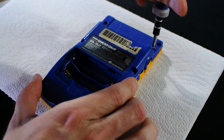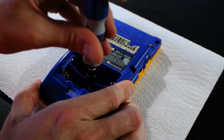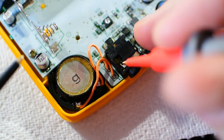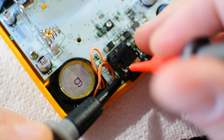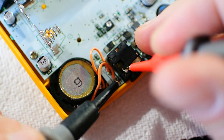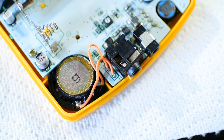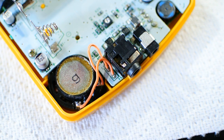What you need to do is disassemble the Game Boy — for this basic troubleshooting, you just need to take the back cover off. It's six screws; they come out pretty quickly. You're going to need a basic multimeter, just something that you can use to test continuity. With the probes of your multimeter, and no headphone jack plugged into the socket on the Game Boy, you're going to want to check continuity between these two points. Those two points in the headphone jack are what make the circuit so that sound gets routed to the speaker when you don't have headphones plugged in. What we're testing by checking for continuity here is if that contact inside the headphone jack is either dirty or broken. If you don't get continuity when checking those two points in the jack, that means you have a problem with the jack itself.